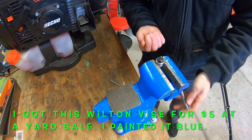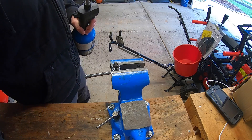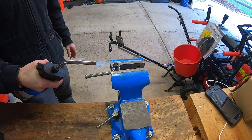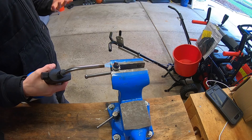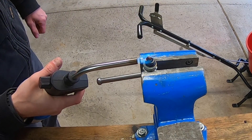Now we're gonna stick it in our vice. I actually have another video on cleaning spark plugs and we're gonna do the same exact thing here. I've got my torch flame and I'm going to heat this up. This spark plug works perfectly fine — there's no reason to buy a new one. I can just do this and it costs me nothing. I'm gonna heat this baby up until that tip at the end of the spark plug turns red.